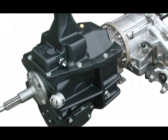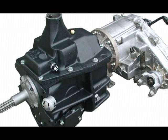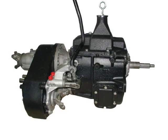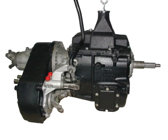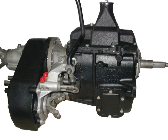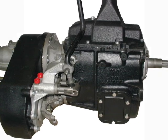The last years of the SM465 featured a direct drive fourth gear switch to signal a lean or cruise mode operation to the GM engine control module, or ECM. These final versions had an aluminum top cover and a revised input shaft and input bearing combination. They were found in the C and K series trucks. Suburbans, however, continued to use the earlier SM465 with the cast iron top cover.